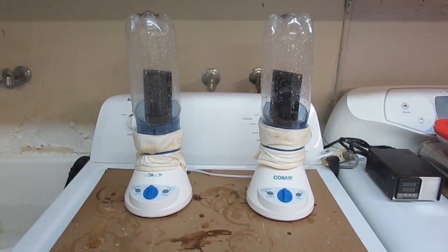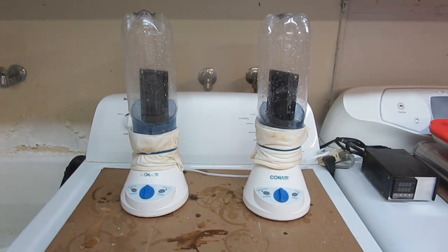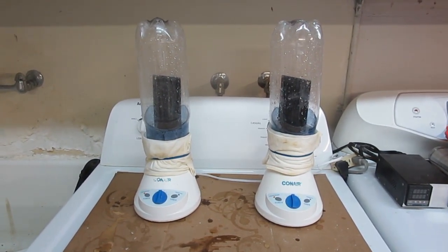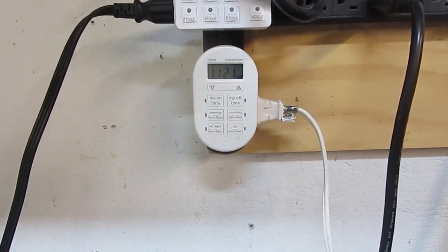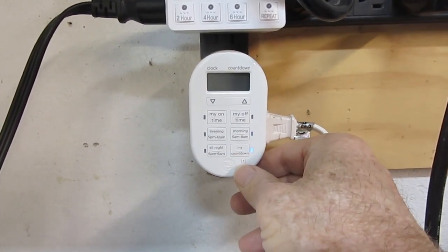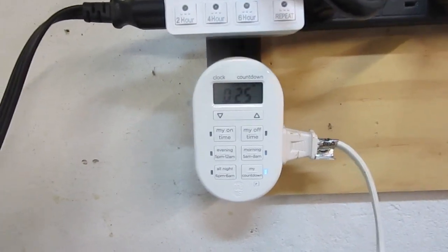It's not enough to depend on the unit to automatically shut itself off. That's because the electronics that control the unit must be powered up in order for the unit to work. Heat will build up on the circuit board, so power must be cut after every steaming cycle. I found that it is convenient to use a plug-in countdown timer with the steamer, so that power will automatically be cut when the steaming cycle is complete.